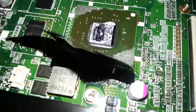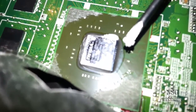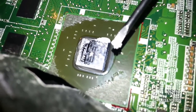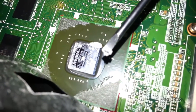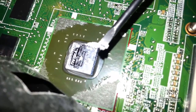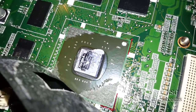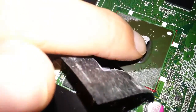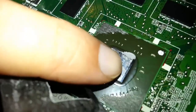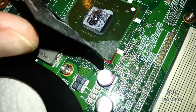You can see here, this is about one millimeter where the plastic was sitting over the chip. That pissed me off - thank God I opened it so I can see that now. I will fix this because it's a shame, it's not great work. About one millimeter of no thermal compound contact and no proper cooling.